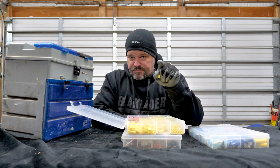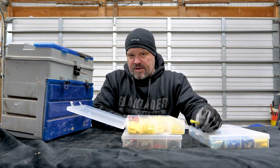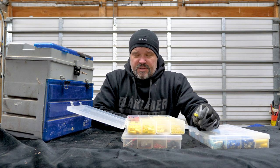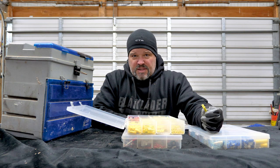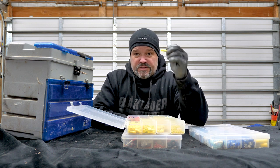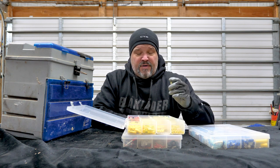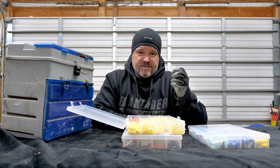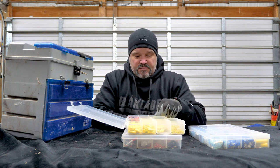I know a lot of diehards will say always solder everything, but I'm not really a soldering kind of guy. It rains a lot here, and trying to run a soldering kit in inclement weather just sucks. I've had a low voltage lighting system installed for 20 years and nobody has ever called me back to say my heat shrink connection failed. Heat shrink butt connectors are expensive though — maybe $30 for 30 of them. In environments where I don't need it, like under a waterproof deck or inside a dry railing post, I'll use standard butt connectors. But we use a ton of yellow.